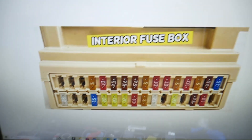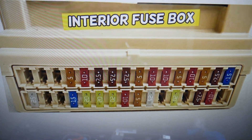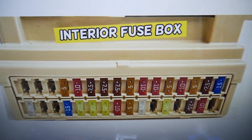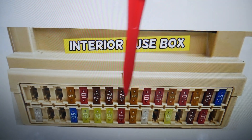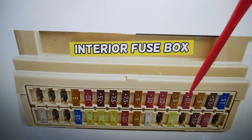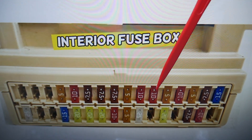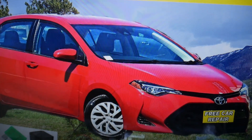So here we need to check two different fuses. By the way, if you guys need to buy any fuses, relays, parts, or tools for Toyota Corolla or any car at a really good price with quick shipping, we will put the link in the description below for your convenience. For the tail lights, we need to come to this row of fuses - that's fuse 17 through 32 starting on this side. That's fuse 17, 18, 19, 20 - so fuse 20 right here will need to be checked for tail lights. Then you go to 21, 22, 23, 24 - and fuse 24 right there is the other one to check.